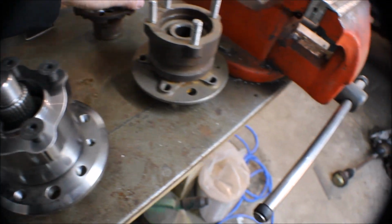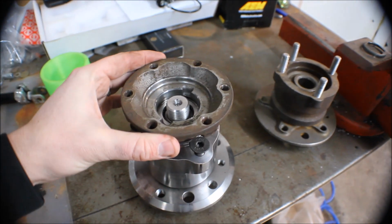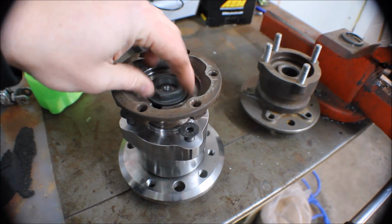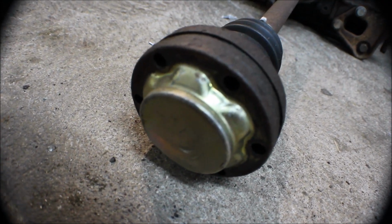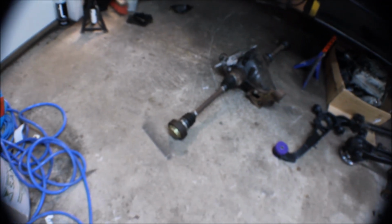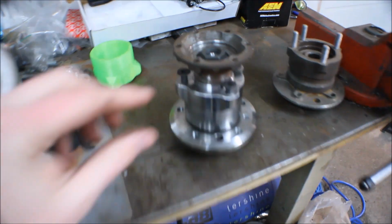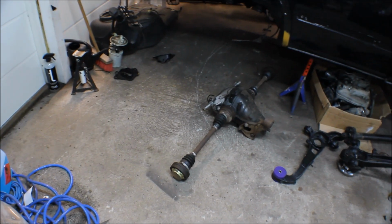So this will sit like this, and the Opel Omega is constructed to have one of these caps right here. Then you bolt it down like this, and then you see this flange right here. It gets bolted into the drive shaft right here. One of the obstacles we could be facing is if this isn't wide enough, but then we will solve it by making a spacer right here to get the proper distance between them. So that will not be an issue.